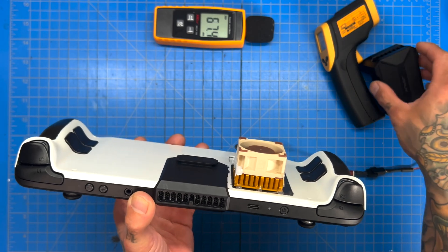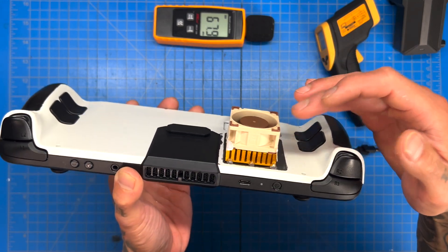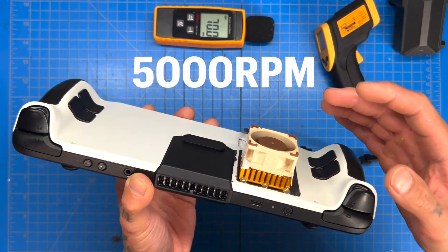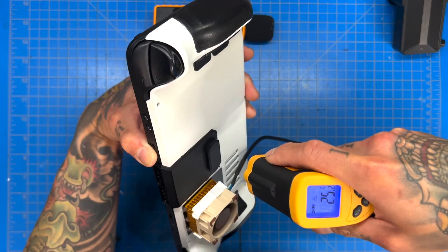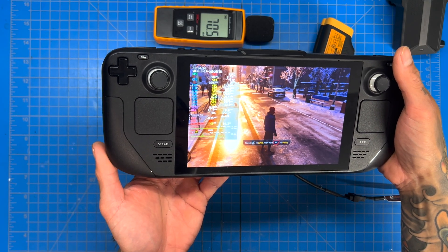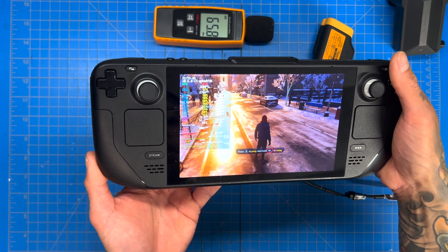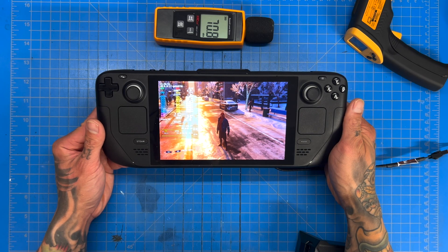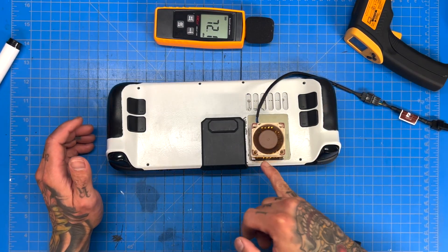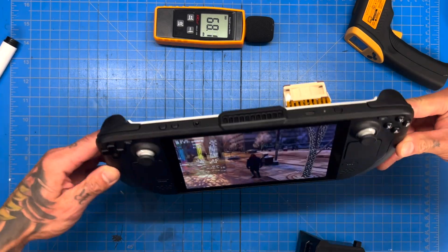This setup is probably better than anything you'd buy on Amazon. The fan's maximum RPM is around 4,500 to 6,000 RPM and it pushes more CFM. Hot spot is down to 25. Looking at temps: 73 — not bad, five degree delta. 72 — six degree delta. Fan speed has dropped to 4,000 then 3,700 RPM at 71 and 72 degrees, so as fan speed dropped the hot spot got hotter, meaning the cooler is working harder.